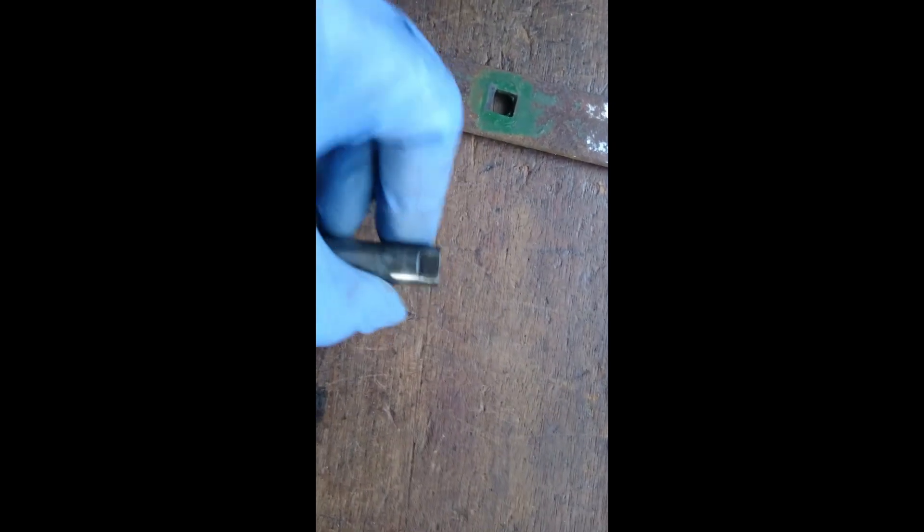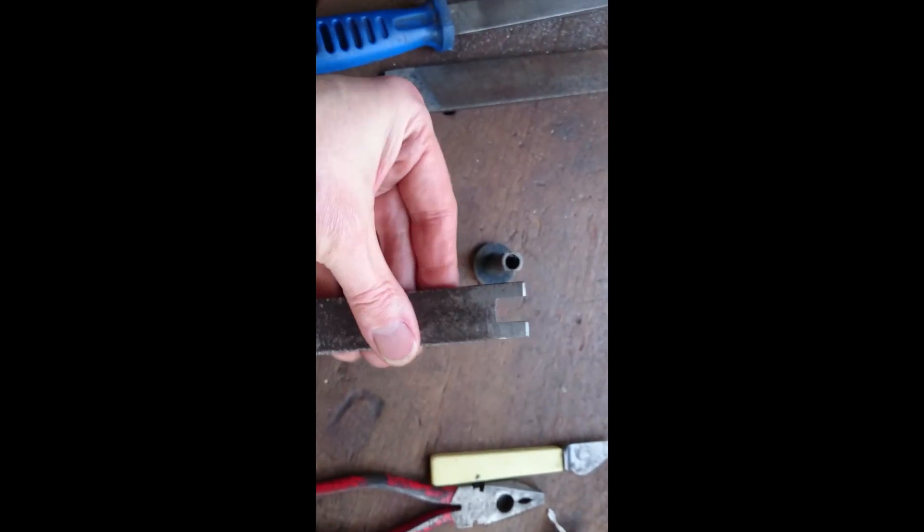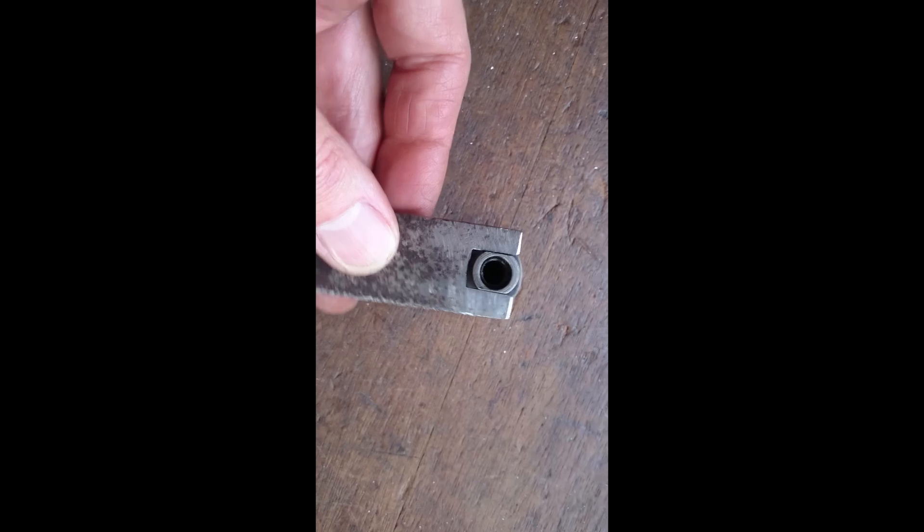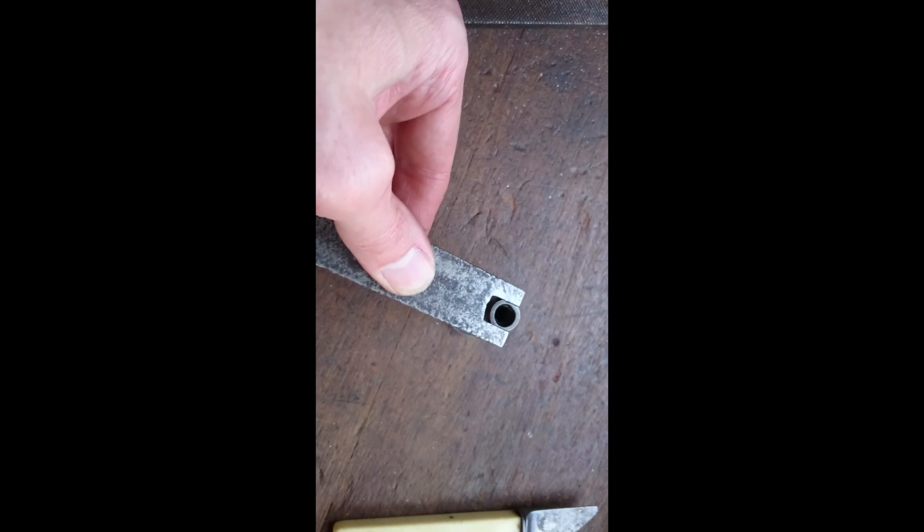In my infinite wisdom I've decided to actually make a tool to do this rather than walk down to my other garage to pick up the tool I made a while ago, which is now getting a bit worn out. So we're going to make a special spanner out of this rusty old bit of lawnmower handle, and what we want is to make it the same width as that there. And that's done - my little tool for helping with the tappet adjustment. It would have taken me even less time if I'd actually bothered to do it carefully and not had to do it twice. So that will now hold the cam follower steady, allowing me to adjust the nuts without it turning.